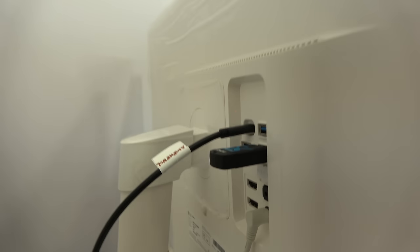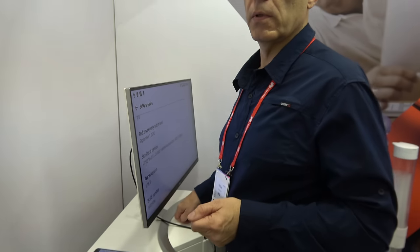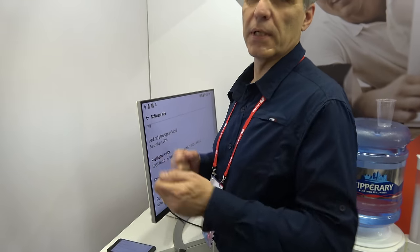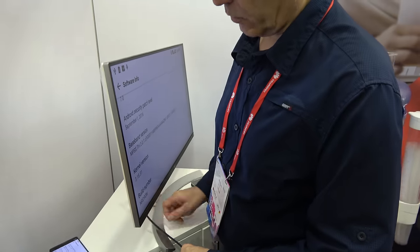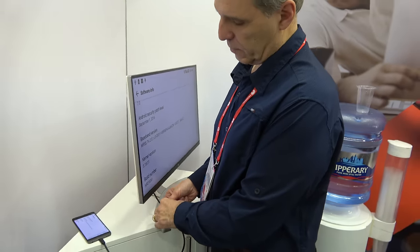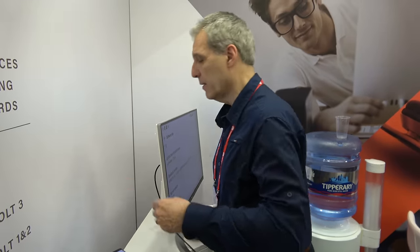This is a Type-C connection right here, but it could have been an HDMI display. And it just works — well, you'd have an adapter, but yes it would still work the same. There would be an adapter that takes DisplayPort and turns it into HDMI, then you'd connect the HDMI to the HDMI port on the back of the monitor or television. There's no cable that can do all that — it needs to be an IC in the adapter box dock to do the transfer to HDMI. Most of them are all active.